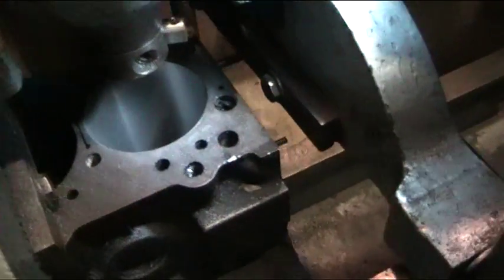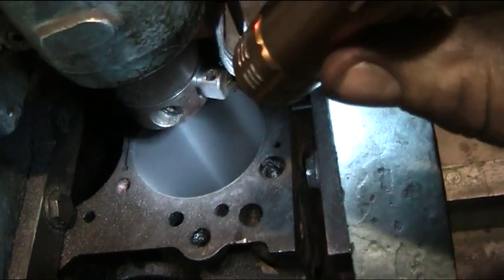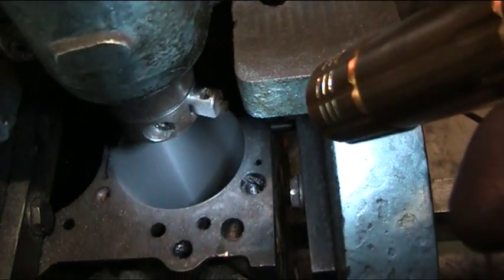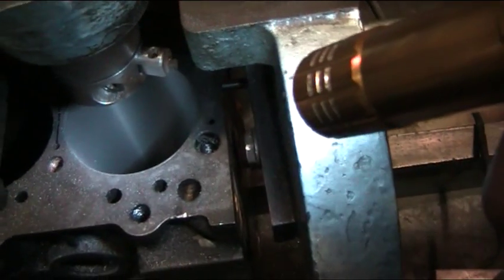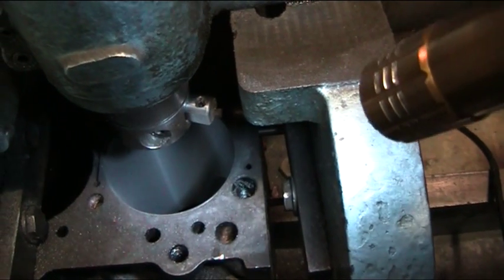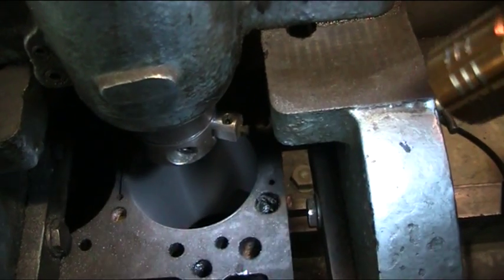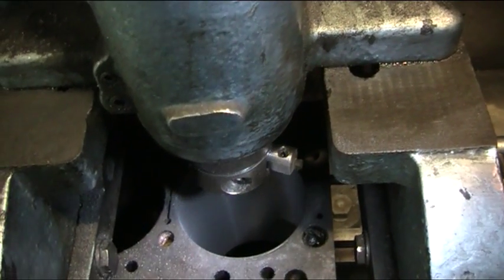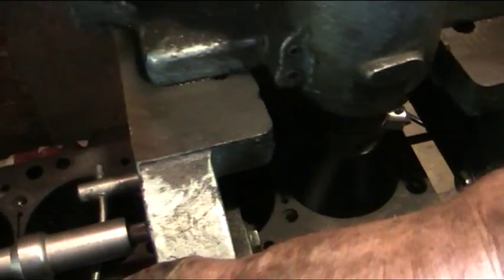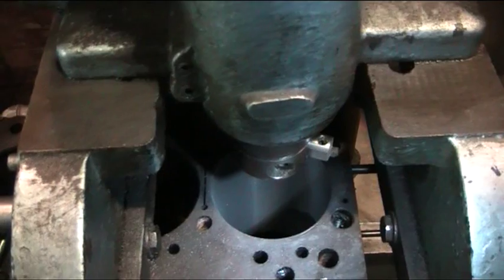Let's have a look at the cylinder — can see the shine there. Very nice finish, even all the way down. Pretty happy with that. As always, this machine achieves a nice finish and cuts the workload down for us a hell of a lot. Much nicer machine than these small Van Normans that are block mounted. This machine actually anchors the block down within the ways of the body of the chassis of the machine, and we have a cam system that locks it down at either side. This is the secondary lockdown so that the block has no chance of moving whatsoever, and it cuts a very accurate path down the cylinder bores.